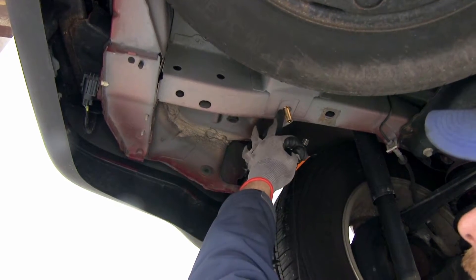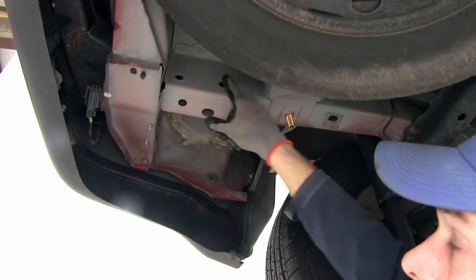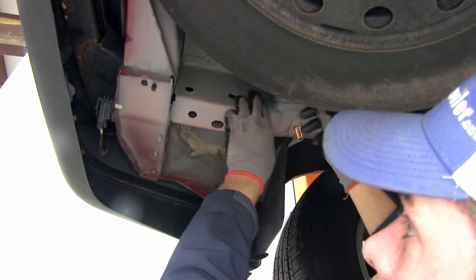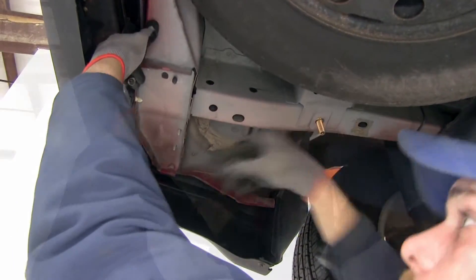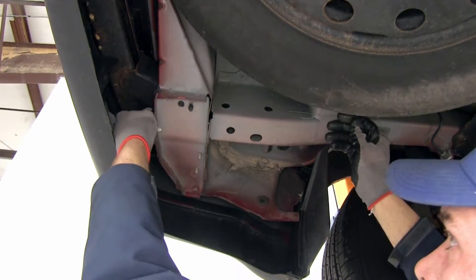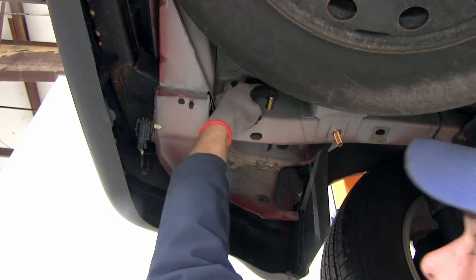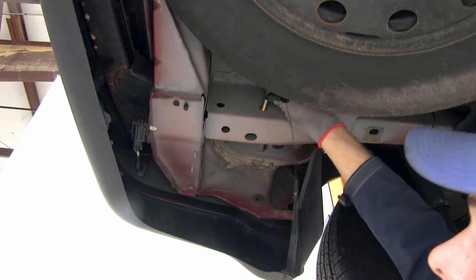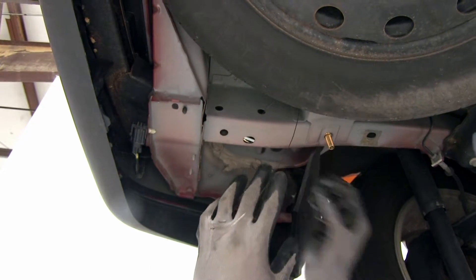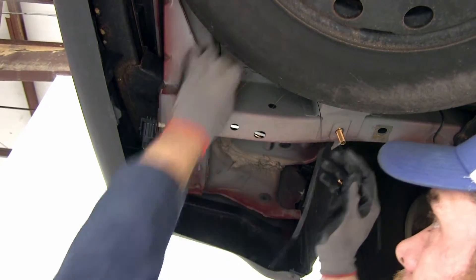We're going to take our fish wire off the lower carriage bolt and repeat the same process for the forward and rear hole on the side of the frame. On both of these, we'll leave our fish wire attached — we'll show you why. Same process: add the spacer block and the bolt, lift it up and into the frame rail, make sure the bolt engages the block, then let it rest back down. As we put our hitch up, we'll guide this through and pull our bolts through to hold it up, then go over to the passenger side and do the exact same thing.